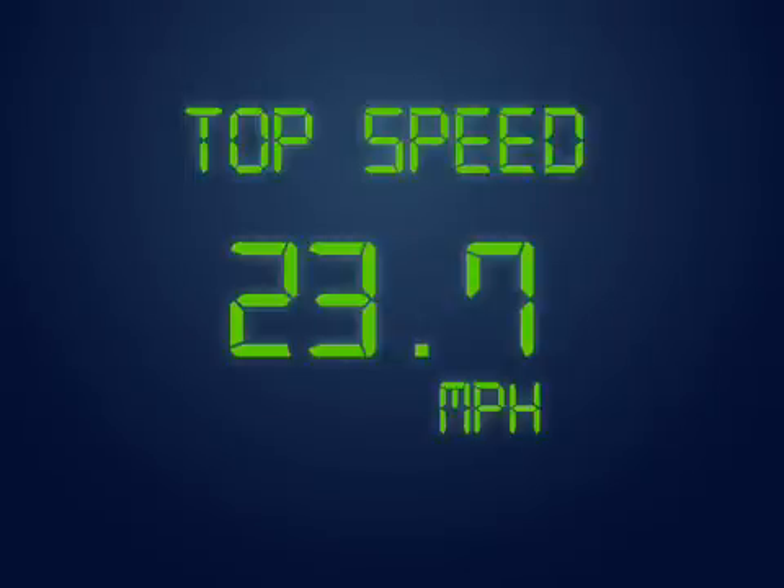Now for the test and review. I did several tests with the bike over a total of 30 miles. On road, the bike is fairly stable and smooth. It has plenty of torque to start from a standing stop without pedaling. Once up to speed, shifting was almost unnecessary — I mainly used a low gear for slow speeds and a high gear for high speeds. Noise from the motor is minimal and can't be heard above normal wind. Around 16 miles an hour there's a slight whine from the motor that lasts about a second and then goes away. Off road there were significant issues with the battery pack in the rear. I broke one bolt and even tore a valve and had to replace the inner tube. The battery pack doesn't secure the batteries inside the rack so it bounces badly against the rack, even on simple dirt trails. My solution was a large strap around the entire bag to secure the batteries down, but I wouldn't try more than 10 miles an hour off road.